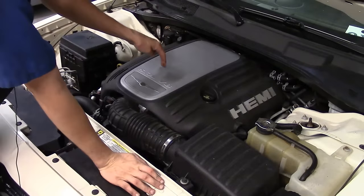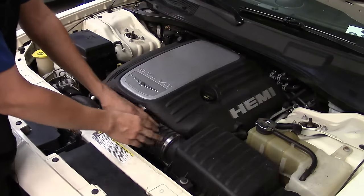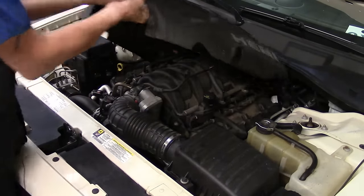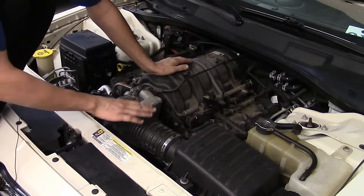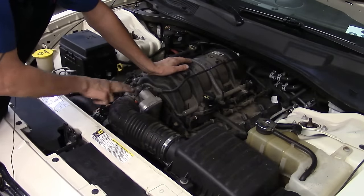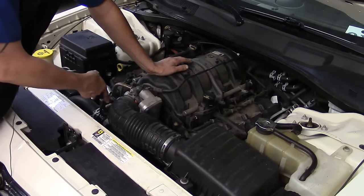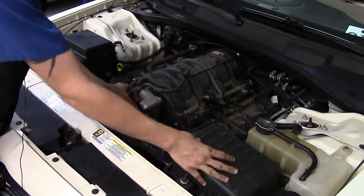This particular vehicle has a 5.7-liter Hemi. One of the first things we need to do is get the air cleaner assembly off, which includes the rubber boot that goes from the air filter assembly to the throttle body. We're also going to have to get the cover off to get to the fastener. We'll grab the trim piece, then move on to the clamps that hold the boot onto the upper housing as well as the throttle body. We can take this off together as one piece — we'll back off the 8-millimeter hose clamp, release the air intake temp sensor connector, and take off the one bolt holding the air filter housing, removing those two things as one piece.